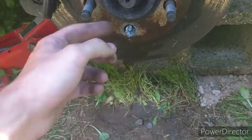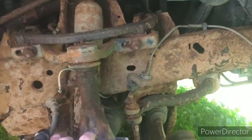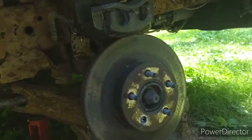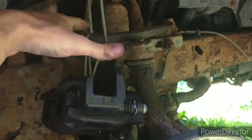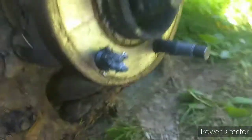Another day — got the wheel off again. I'm going to take off the caliper and then the rotor, try and bang out that lug bolt, and then move on. Once this side's done I can do the side that was bad to begin with. Caliper is now off. If you don't have a toolbox — or in my case a tool bag — you're probably doing something wrong. I hung her up with a zip tie to get her out of the way.